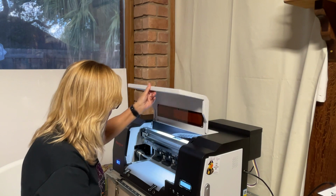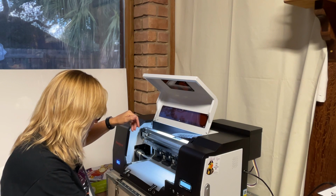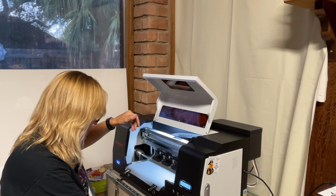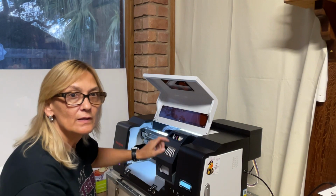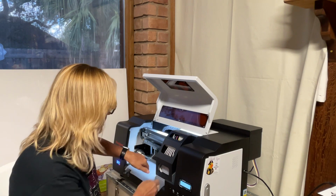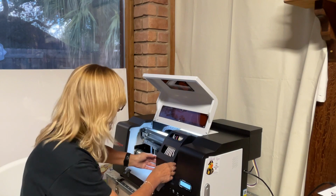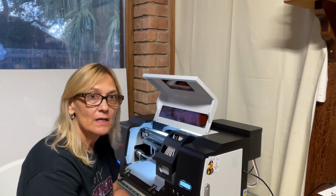And then I came here to the front and I moved this over. This is where the ink head is, right? Took this little thing off. It took 2 screws, one on this side and one on this side, took it off. And I had the syringes and I pulled the ink into, I forget what these little things are called. If I can remember, I'll put it on video. Dampers. It's dampers. So I pulled it into the dampers and I got rid of the ink.